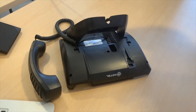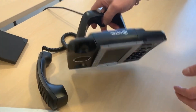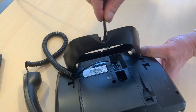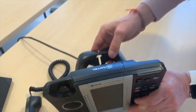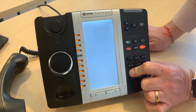To set your phone up in Teleworker and insert the settings you have been sent, you need to unplug your phone first. Then pressing the 7 key on the front of the phone and keeping it held down, plug the phone back in as before into the second socket.